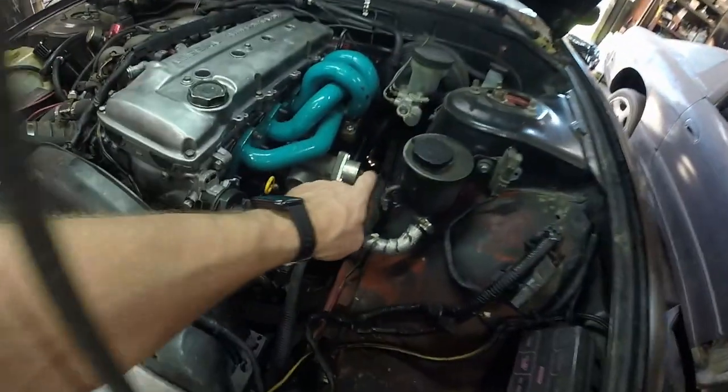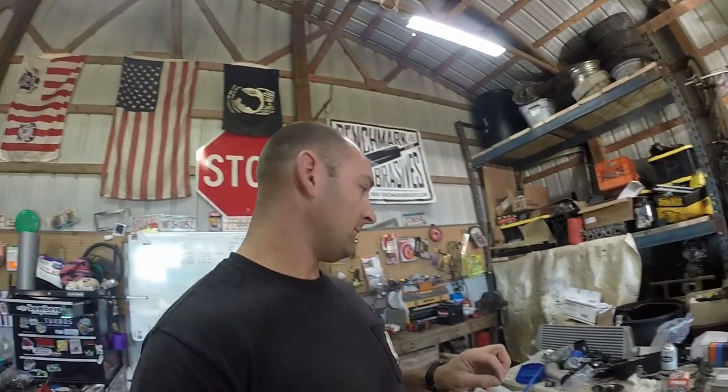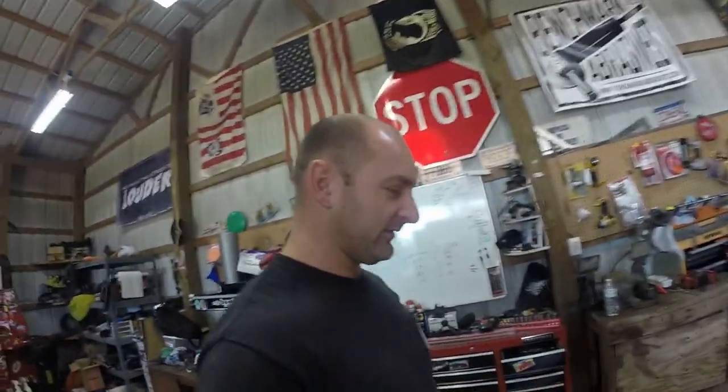That will also cool down the oil inside the turbo, so we've figured those two things out. I still need to get more coolant line and an adapter for it. I also need to get a bigger hammer - my downpipe is still potentially hitting the body. And we've got motor mounts to put in. Before we can finish the downpipe, we need the motor mounts in because it raises the motor, and if so, I'll have to beat the body further in so the downpipe fits.